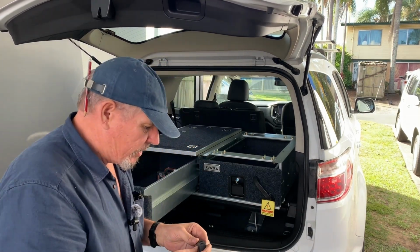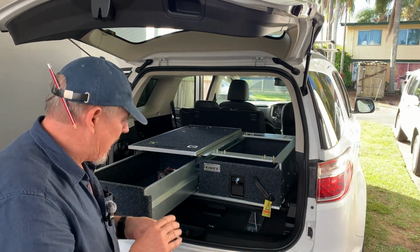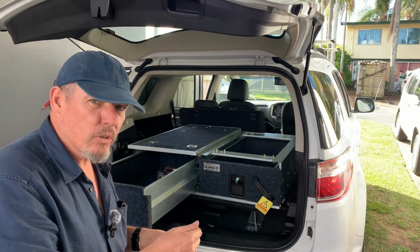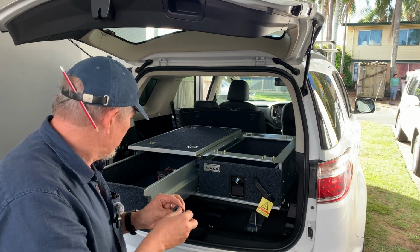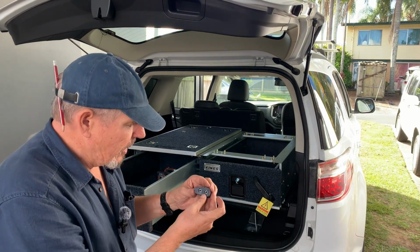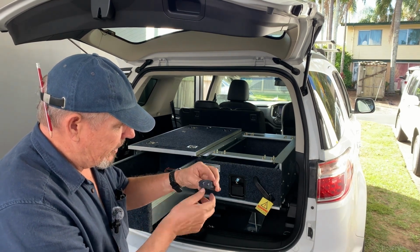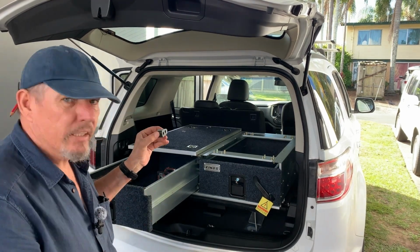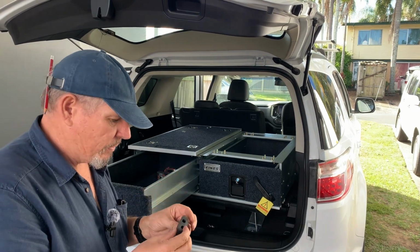So yeah, when you're putting them in, it is difficult. I actually drilled, the carpet is laid after they've drilled the holes, so you can't find the holes. So I actually drilled through the carpet while they were out, just so that I could eyeball and see where they are. Makes it a little bit easier. And yeah, as I say, flat side down, there's a chamfered side, flat side down, nuts to the outer, that little round bit to the back, because that's your buffer at your back. Nice big flat edge to hit the roller bearing. That's the way to install them.